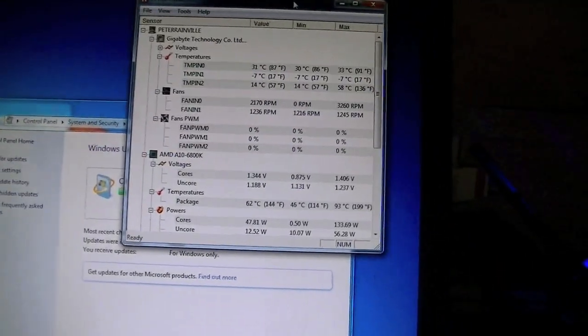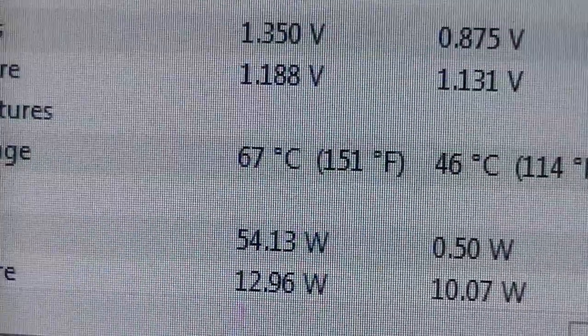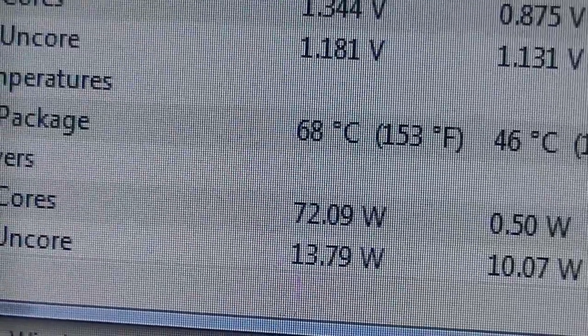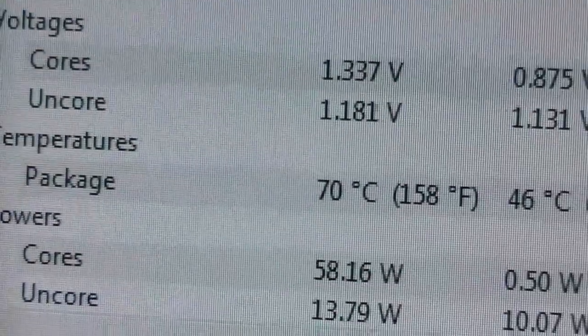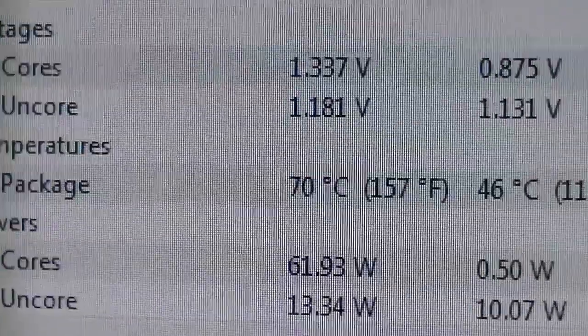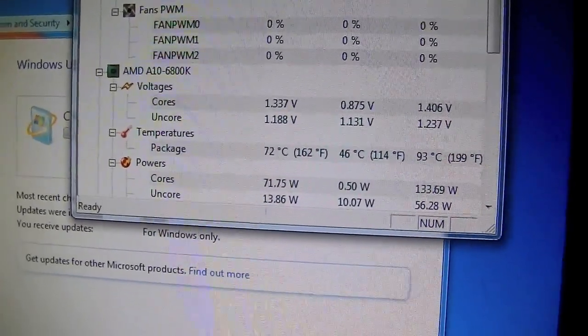We do want to look into that really, really hot CPU temperature, also replace that rear fan, and order the power supply when it actually has the outputs I need. But the temperatures fluctuate quite a bit. If you're watching them, they jump, not so much right now. Yeah, see, this jumped 10 degrees Celsius. That can't be right. So I think what I'm going to do is just shut the computer off, pull the heatsink off, and feel if the CPU is really hot or not. If it is, obviously it's running hot. If it isn't, then not a problem, because the software might be wrong.